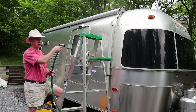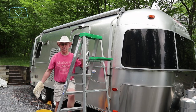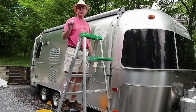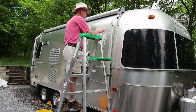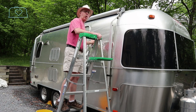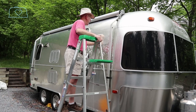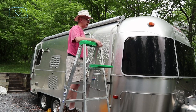Obviously, like washing a car, you want to make sure your surface is thoroughly wet. Grab your mitt — and here's the first tip I got from the Airstream factory service reps, because I'd been doing it wrong for years. The service rep was adamant about going with the grain of the metal. The grain of this section runs this way, so that's the proper method to wash and wax. The end caps go that way; the grain of the metal goes this way — so wash this way, with the grain of the metal.